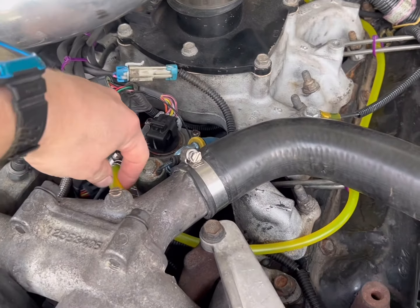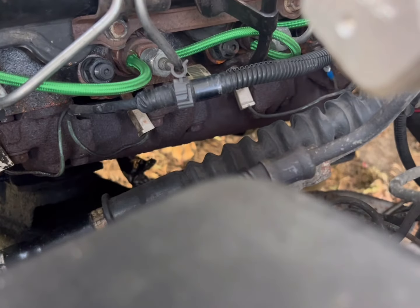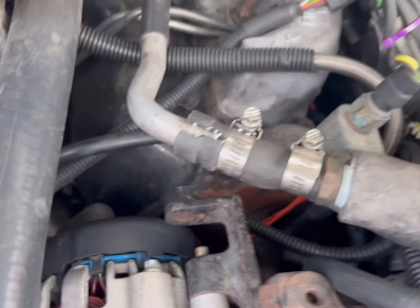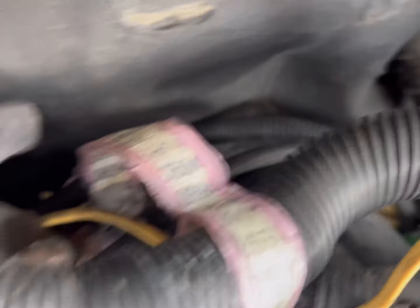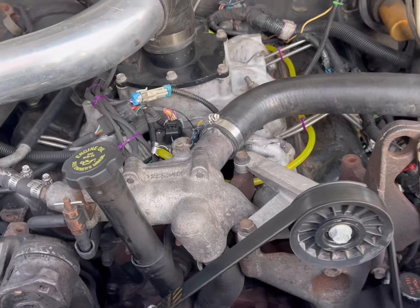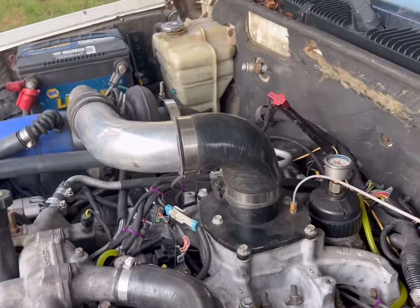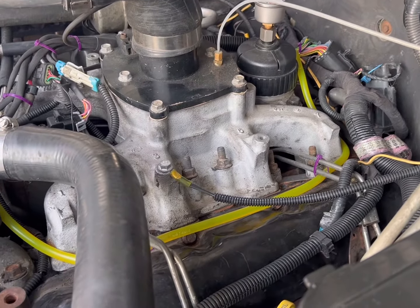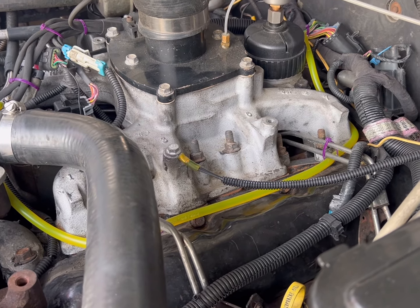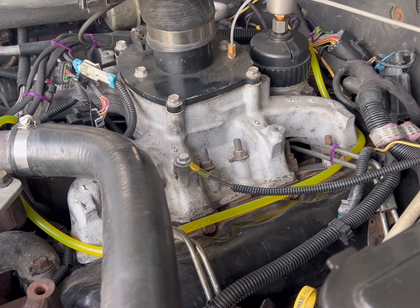Here's our new return system. I ran it up along the exterior here. I capped off my front injectors for the return side — hard to see, but that one's capped and that one's capped. Our returns actually come off the rear injectors now and they run up to this little block fella down there. I ran this all externally because I'm tired of taking the upper and lower intake out to work on this truck. It has leaks, it is a farm truck now, it gets used as such, and when things leak or break I much prefer to be able to go at it from the top side and get it taken care of.